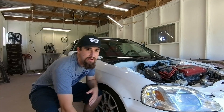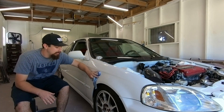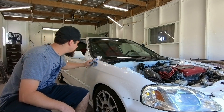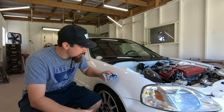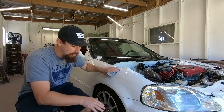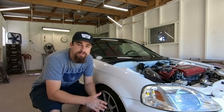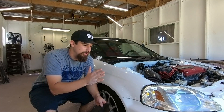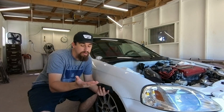So that's the purpose of wet sanding and buffing. What I'm going to do first is wipe down the bumper with just some soap and water. This bucket I have — this is where my sandpaper is sitting. A good tip is to let the sandpaper soak as soon as you get to the shop, so that by the time you get to your part the sandpaper will be nice and soft and ready to go. I wipe it down to make sure there's no dirt on it, then I go for my 1000 grit sandpaper. Any big flat areas like on the sides of the doors, the hood, or the roof, I'd recommend sanding with a block so you don't get any real deep scratches. But an area like this where it's nice and small and around a corner, I just use my hand.